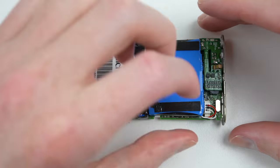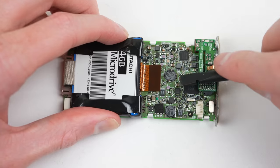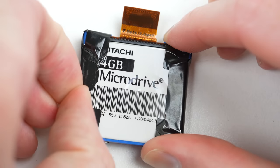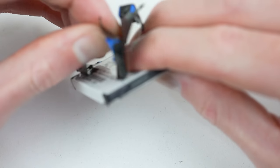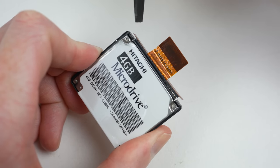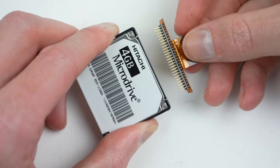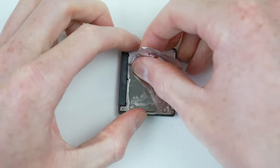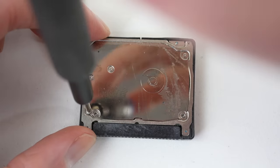On the back of the unit, we'll disconnect the original battery from the iPod mini before detaching what Hitachi is calling the micro drive, which is another word for a very tiny hard drive. Not only are we going to be replacing it, but I'm going to take a closer look at the micro drive itself and disassemble it to see what it looks like inside — after all, this one doesn't work anyway. With the rubber bumper removed, next to come off is the flex cable that interfaces with the logic board. To get a closer look inside the drive itself, I'll need to remove the outer sticker to reveal the hidden screws below. These screws are all Tri-Wing, which are pretty common nowadays in products like the iPhone.